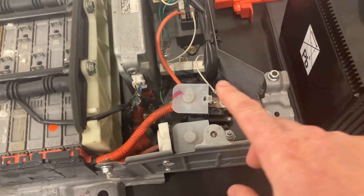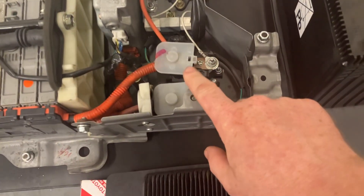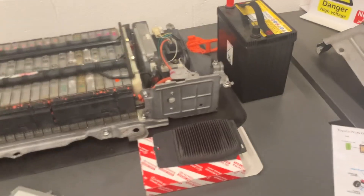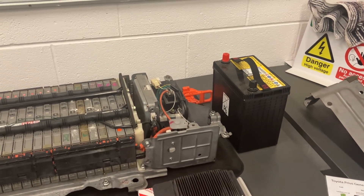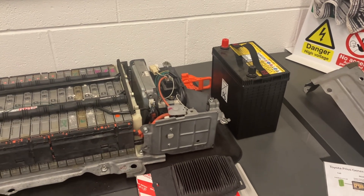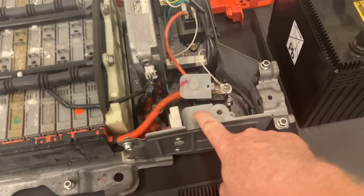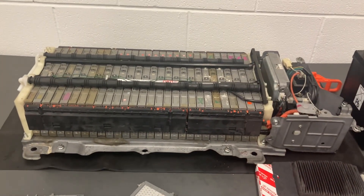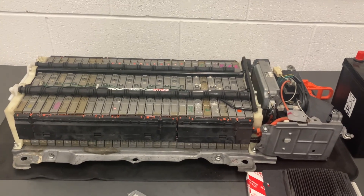Having the relays controlled through the 12 volt battery means that if you disconnect it at the negative terminal, it powers down the relays, and the voltage cannot leave the battery. So if you're going to disconnect a battery — seek professional advice before you do — you would ensure the keys are removed from the car, check that the key is not found and the car is isolated, then disconnect the 12 volt battery at the negative terminal. That powers down the relays, then remove the service plug from the port at the back, which disconnects the bus bar link and reduces the voltages down to individual modules so it can't come out as high voltage.